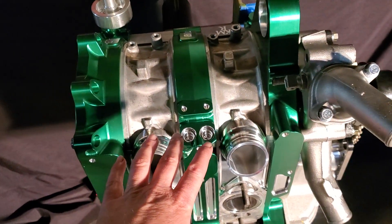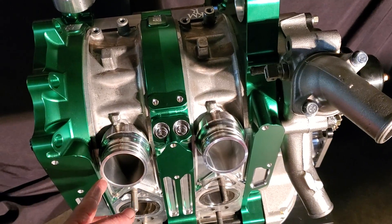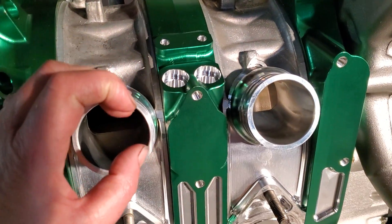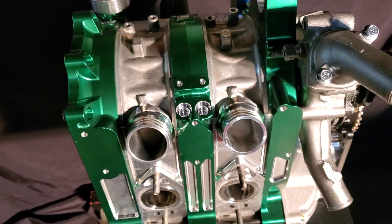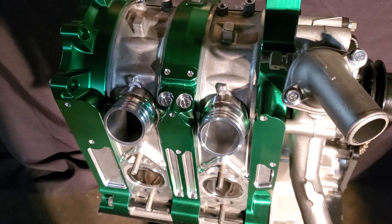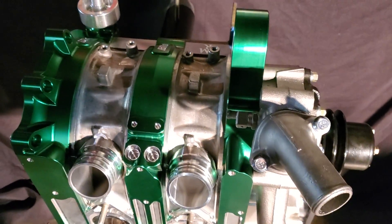It's also a peripheral port. This is going to be a boosted motor, so it's a little unique. We had Chip Ursu partner on this. Wiggins style clamping to ensure a tight seal. We actually moved the port timing up and although it looks big internally, it's narrowed down to a specific size and the port timing is very specific for boost applications. They're also screwed in metal to metal with a metal plug insert, ensuring long-term reliability. This is all really new, neat stuff to the rotary industry being combined into a very custom motor.